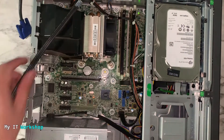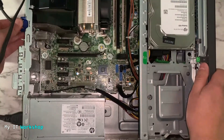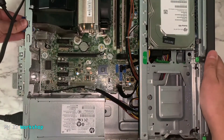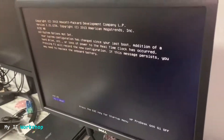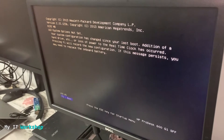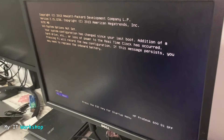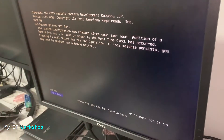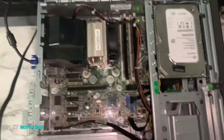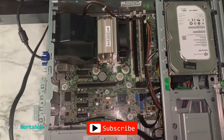Now I'm connecting the monitor. There is a beep sound because there's an error. Allow me a few seconds to adjust the camera so we can see the monitor. The computer is working — you can see the HP ProDesk 600 G1 SFF boot screen — but it's showing a CMOS battery error: the real-time clock has lost power, so it's asking to replace the battery. I'll do that in another video, but the computer is working and you can bypass that error — Windows will load with no problem.